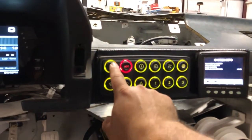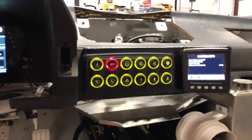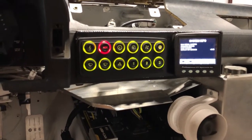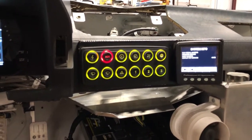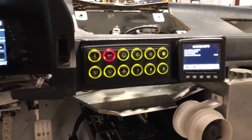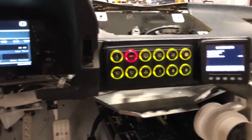If you wanted to turn the car on, we can do this — it'll turn on main power, which will actually fire up the ECU, fuel pump, and all that other stuff. We're not going to do that right now because I don't want the fuel pump running for an extended period of time; we still have to purge the tank and put fresh gas in it. But that's basically how the CAN switches work.